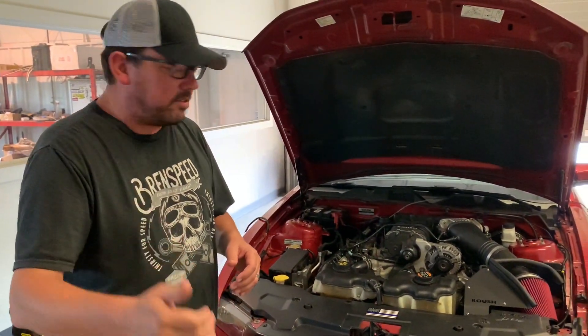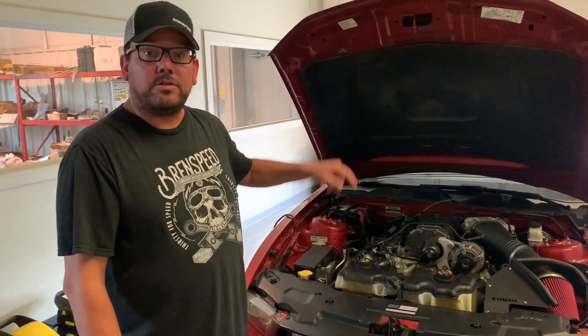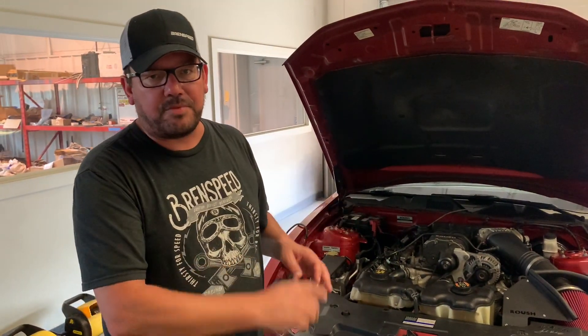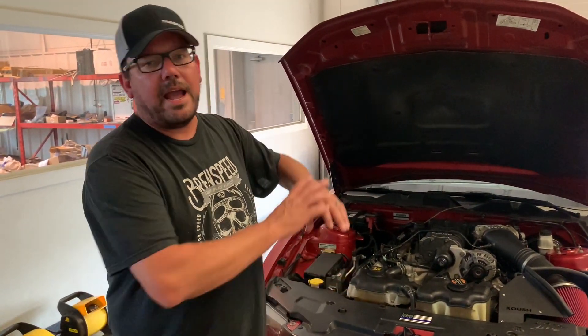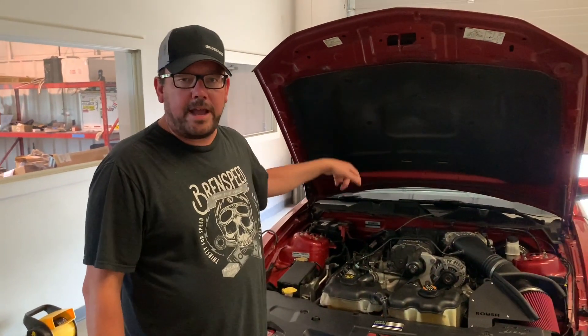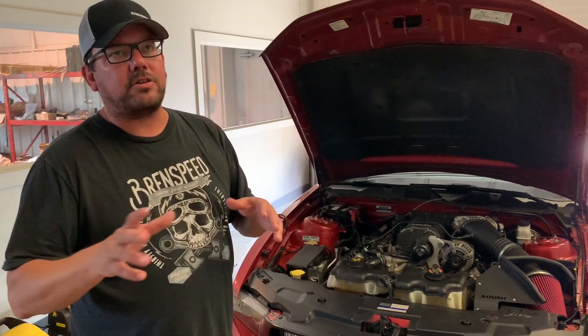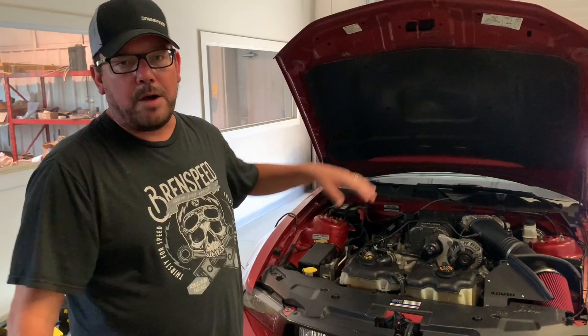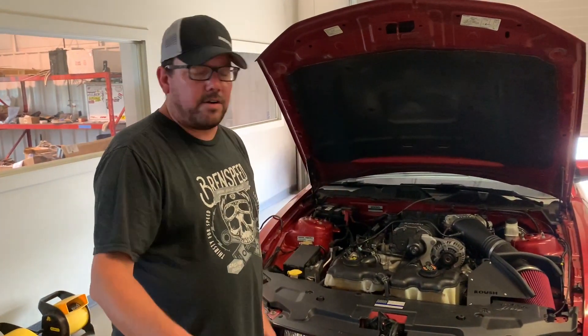So for a 490R, what do you get? You get an air induction system — that's what we did on this car. We also installed hot rod cams for that lopey idle. We had some hot rods in stock and installed those. Colder spark plugs. Of course, we do a fuel pump upgrade and a 2.49 supercharger pulley, which is going to give about another 2.5 pounds of boost. For an 05 to 09, same thing — 2.49 supercharger pulley. A little bit different air induction system because the inlet is on the other side. We did pipes, long tube headers with a catted H-pipe. From the factory, this is car number 500, rated right around 430 flywheel horsepower and 400 flywheel torque. My goal today with the hot rod cams, headers, and our upgrade is to beat those numbers at the rear wheels. Stick around and watch these dyno pulls. If you haven't already, subscribe and notify.